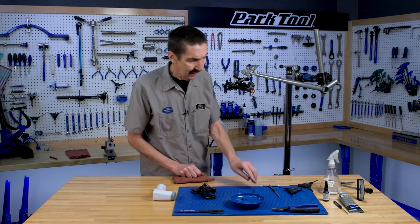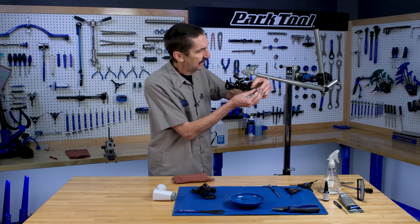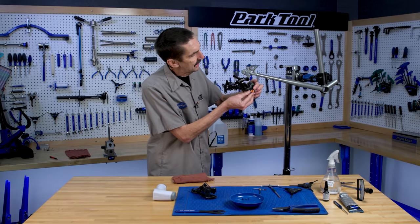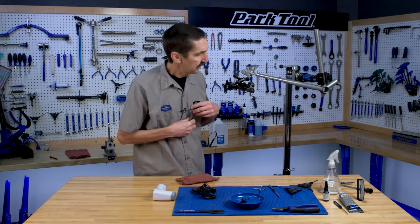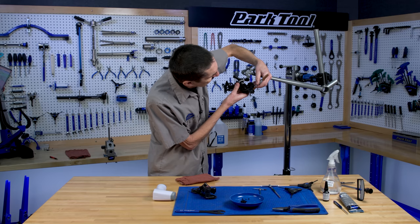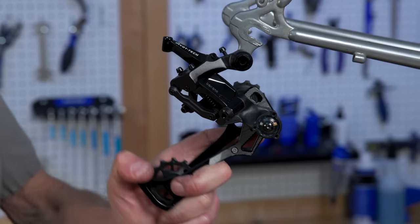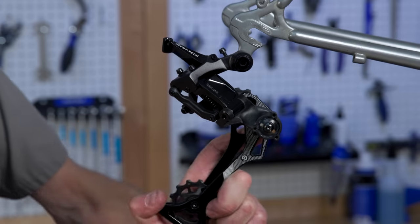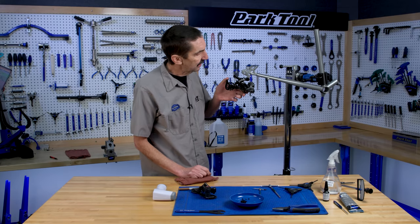Let's have a quick peek inside at the magic. Companies vary on how they take this up, but they all have to lose some energy — it's going to be done through friction. This one has a cap that can come off. Inside, Box has what they call a clutch pack. I'm going to put a little mark. See that little gold mark right there? Watch what happens — we hit a bump, it winds up but doesn't come back. That's the friction right here. Friction comes back easy, marches all the way around.